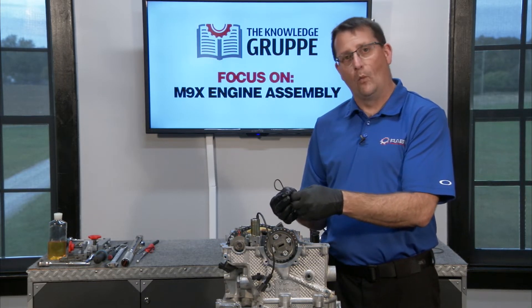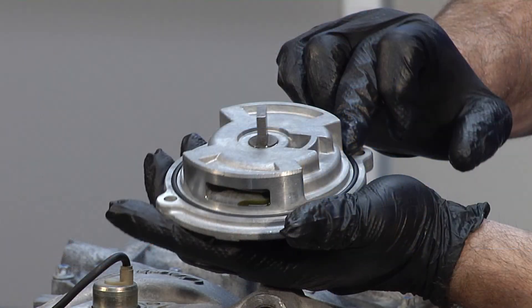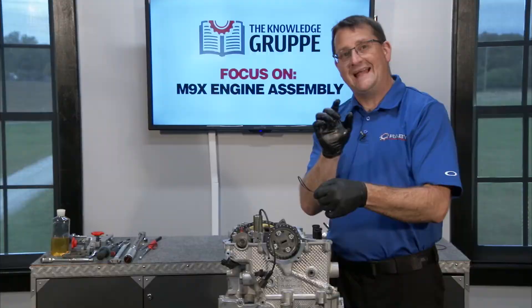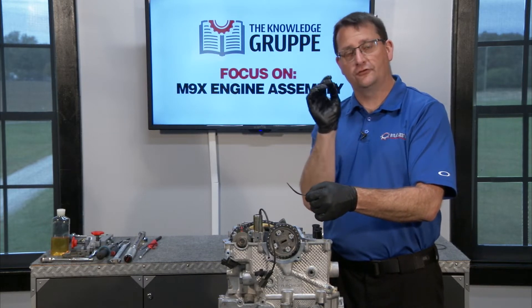This used to seal up one of the scavenge pumps in the engine when it first came apart. This seal goes in the back of the scavenge pump — you'll actually see us installing a new one in the next couple of scenes — and it seals off to this area of the cylinder head. It's also the perfect diameter to work as a tool to help ensure that we do not have any extra sealant getting into these areas.